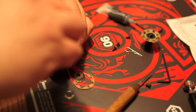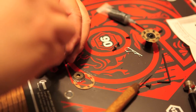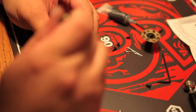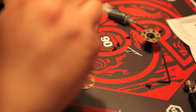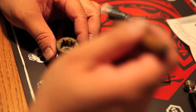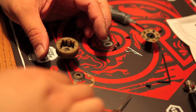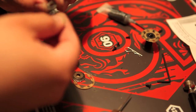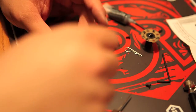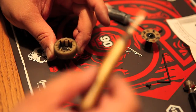When you rebuild your differential gear, you have a couple of options: you could buy a rebuild kit, buy additional shims to reshim the kit, or buy a brand new differential. In this case I'm going to construct this from a differential rebuild kit, which retails for about nine to ten dollars at your local hobby shop. I'm removing the old o-ring and putting on the new shim.